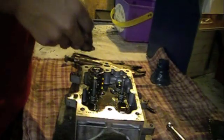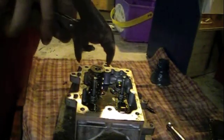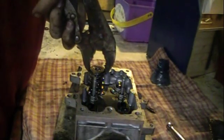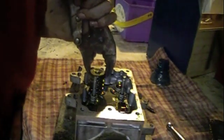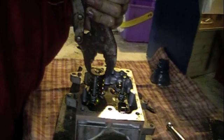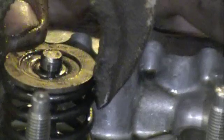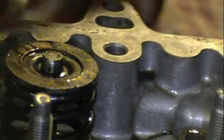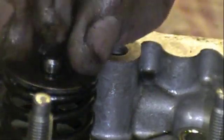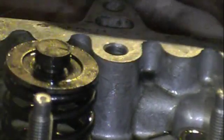You have your top ring and a retainer. Grab your retainer and set it down. Like I said, it's harder to put it back on, but after a little bit of wiggling you can always get it back on. One side's on, but then you need to kind of maneuver it. Now they're both on. This motor actually has little caps that go on there. Then you just do the same for the other side and you're good.